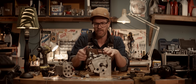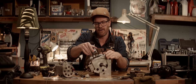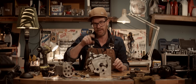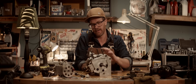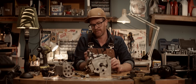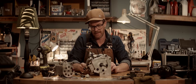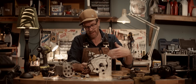Welcome back to my garage. Last video we realized all the bearings in my engine are gone. They've been worn down by the abrasive goo from running the carbon fiber rotary valve against the aluminum surface and also the PTFE surface of that frying pan insert I made. We need to fix that problem before we can continue testing and experience more goo from rotary valve abrasion.